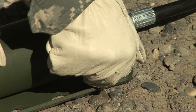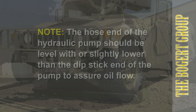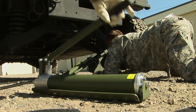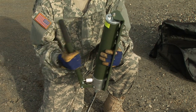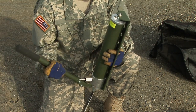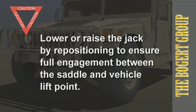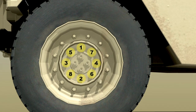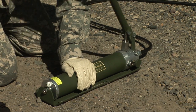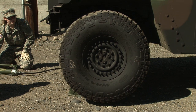Close the external pump valve by turning it clockwise. Pump the handle on the external pump until the jack saddle has nearly reached the vehicle lifting point. The pump can also be operated by holding onto the pump reservoir with one hand and the handle with the other while the hose end is pointed down. Check to see that the saddle has full capture on the lift point. If not, lower or raise the jack as required to reposition it to ensure full engagement between the saddle and the vehicle lift point prior to lifting the vehicle. Slightly loosen, but do not remove, the eight lug nuts on the affected wheel. To lift the vehicle, pump the handle on the external pump using smooth, full strokes for best results. Raise the vehicle just enough to remove the damaged tire.